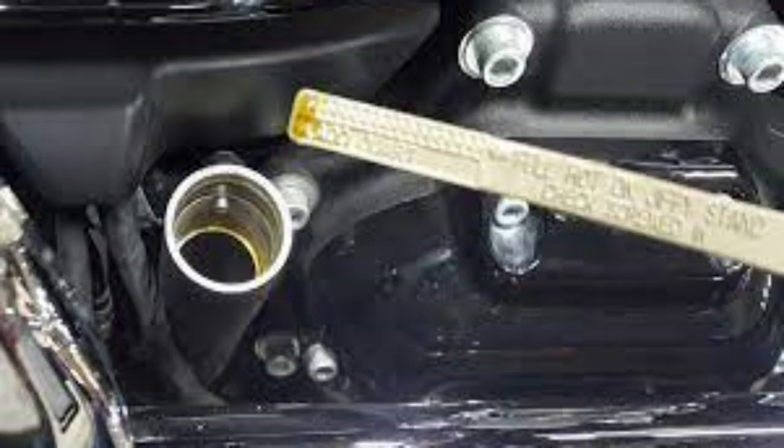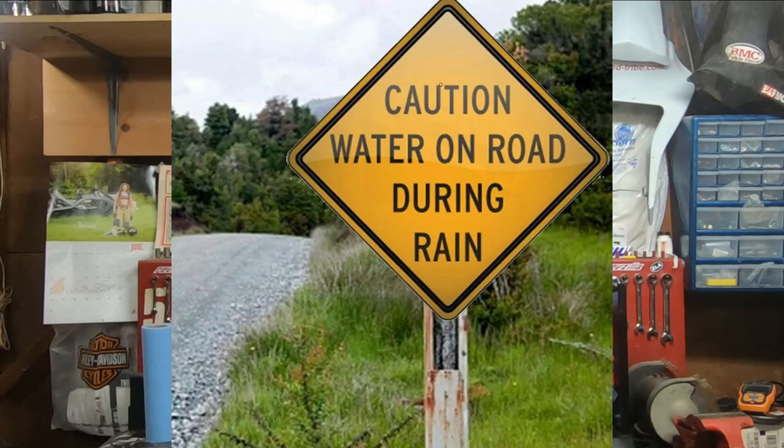You go to your third stop after riding some more, and then all of a sudden the oil level's back up to normal where it should be. This is a surefire sign that you might be having some sumping issues going on, meaning that oil that should be in the oil tank is getting left over down in the sump of the engine, where it should not be. Along with hard starting and disappearing, reappearing oil, you may also notice a huge drop in fuel economy.